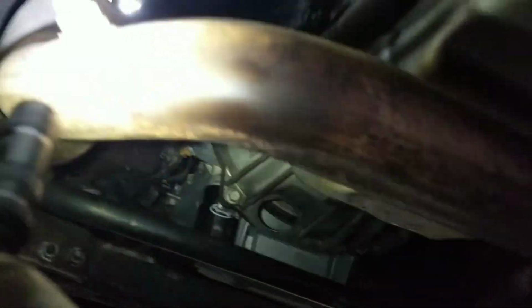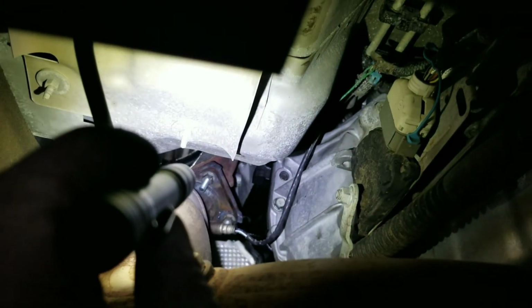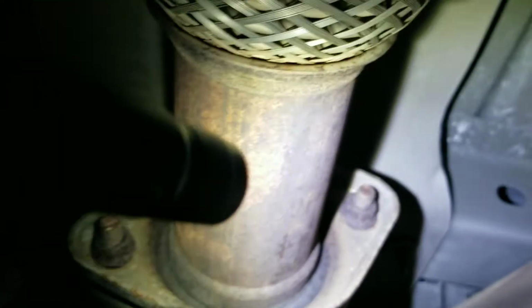Then once it's done, we're gonna remove the full exhaust with the 6 bolts or nuts. It's gonna be 15 millimeter, 3 on the left, 3 on the right, up there. So remove those, and then we're gonna remove these 2 from here, and the whole Y piece is gonna come off. See, you have 2 sides, one here, one there. This full piece is gonna come out.